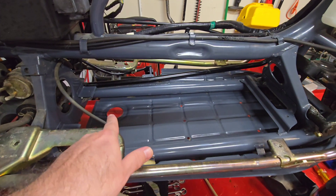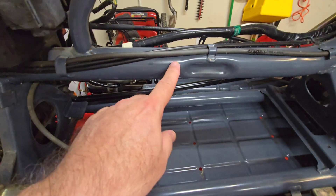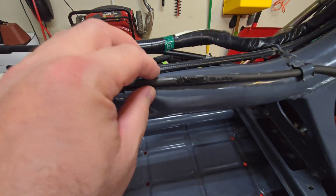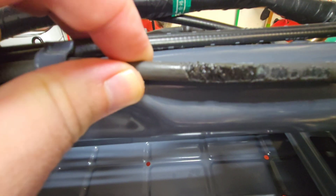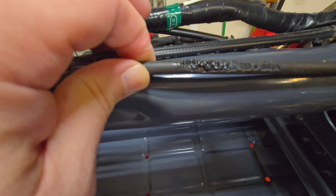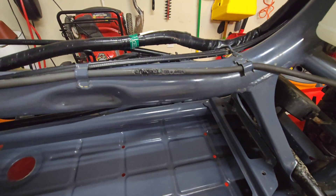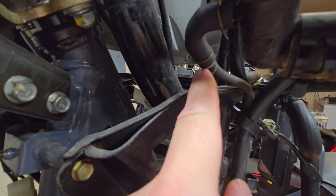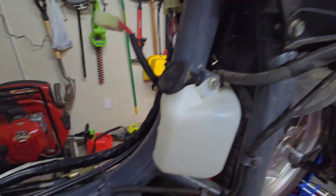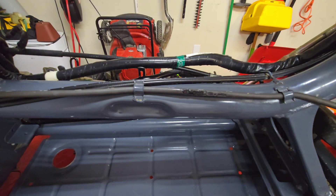So I started beautifying, as you can see right here, and I started doing some investigating. It must have dropped from this bar. You can see it — but I didn't realize that it was all chewed up. As you move it around, the coolant is coming right out of it. That line goes all the way up here, right next to the cap, and then goes all the way to the back of the bike, to the carburetor. It's called a carburetor heater tube — that's the proper name. It's got to be replaced.